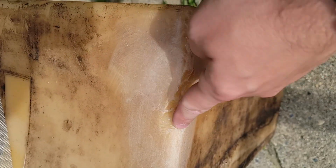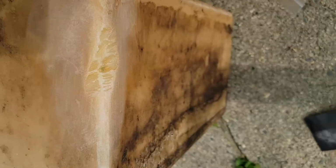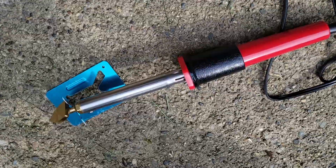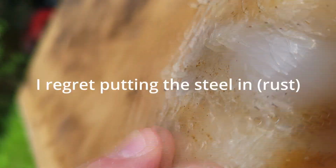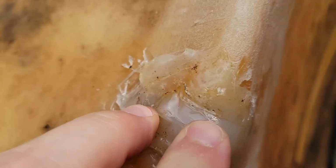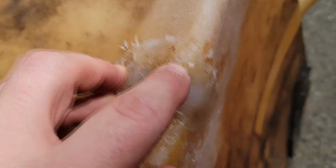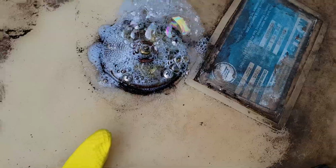So I just sanded this down with 80 grit sandpaper. I got my LDPE rods, and I got the cheapest plastic welder on Amazon. Alright, and there's the after. It's actually got some steel in there. Now to pressure test this. The patch is holding, but now the seal went, or it's that screw.